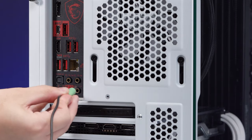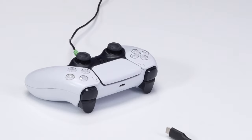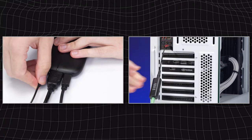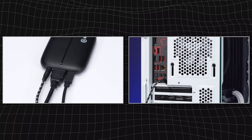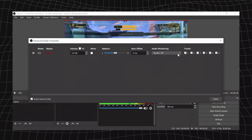To mitigate latency, you can connect an aux cable from your PS5 controller to the line input of your computer, since this avoids the extra latency of a USB capture card — even if that latency is ultra low, the analog line-in will be a little lower. If your controller is plugged into the PS5 for continuous power, you'll need a ground loop isolator to prevent audio interference. You can also use Chat Link Pro on a second controller without a headset connected, which achieves the same effect as an aux cable and ground loop isolator with just one higher-quality cable. Remember, line-in only applies to the stereo input on the back of a desktop motherboard — do not use the mic input.